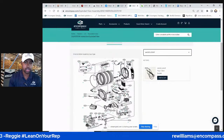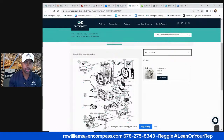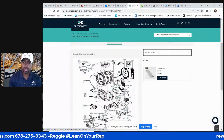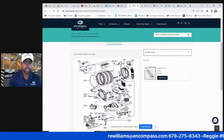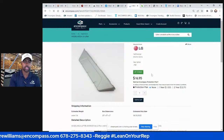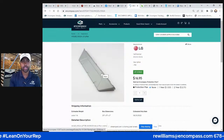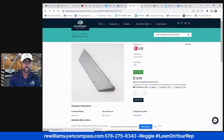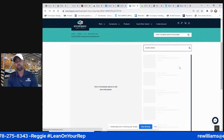Another upgrade, upsell. You know, I was talking about upsells in one of my videos. The fins. Here we go. So the fins here, we call them lifters. And that's another good dryer maintenance, because when you hear that drum turn and you hear those coins inside these fins, you point out to the customer, hey, you hear that noise? I can get rid of that noise as part of the maintenance package I'm going to give you. So you can include that in whatever else you're upselling. You take the fins off, you clean them out, get the coins out of there, keep it from making that racket, make it a much quieter dryer.